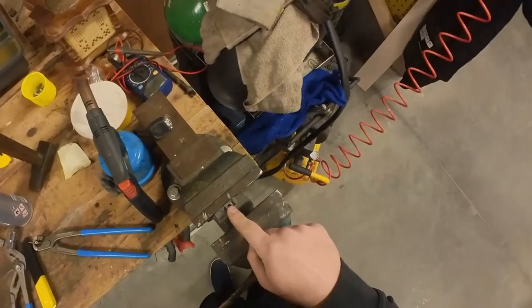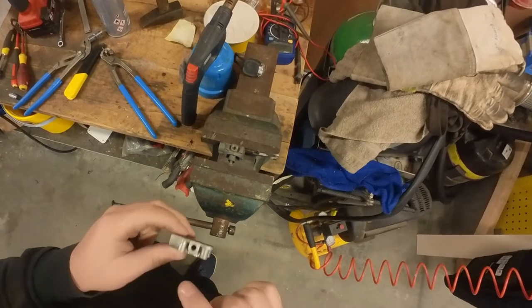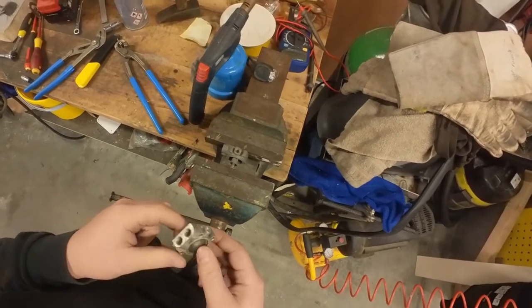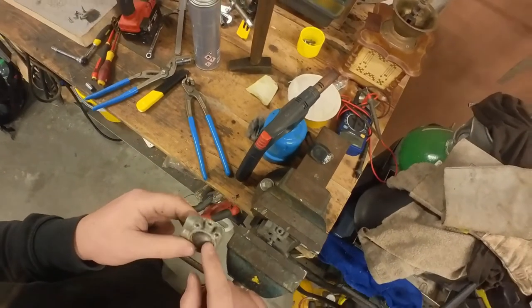So for some reason, these valve seats are completely stuck. I've actually checked with the fuel pump of my 3800, and it's actually the same issue. So I think that might be the problem why my fuel pump keeps failing. I think there's only one of the two balls that is working, because the other ones are stuck.